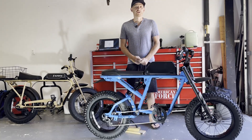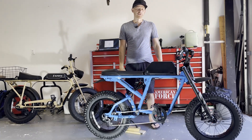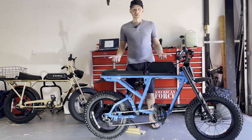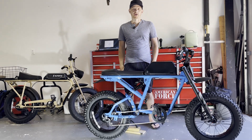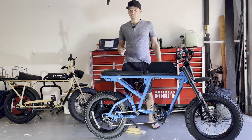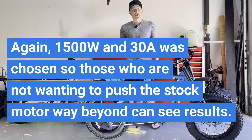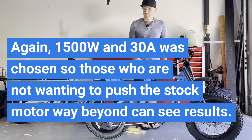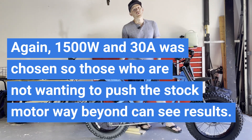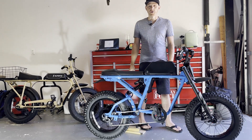That wraps up another episode of Build It Tune It EV. Today we went over the 48-volt, 52-volt, and 72-volt comparison. The 72-volt came out on top — not a crazy result. There was a slight difference between the 48 and the 52, with the 52 being slightly quicker, and then the bump up to 72 volt was a little more than that. Remember, we limited the power to 1500 watts in the controller and limited the battery to 30 amps. I did this to keep it fair so each battery was easily capable of producing the power, giving a fair comparison for the stock motor. We got a comparison across the 0-to-20, 0-to-30, and eighth-mile marks between all three voltages, with the Phase Runner software overlay and the Draggy video showing the power drawn and corresponding times.